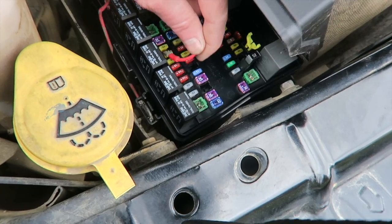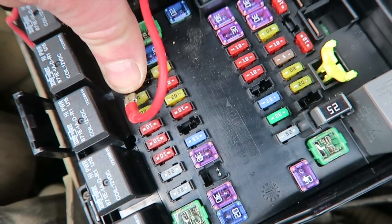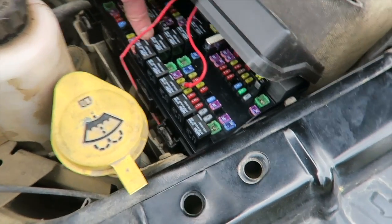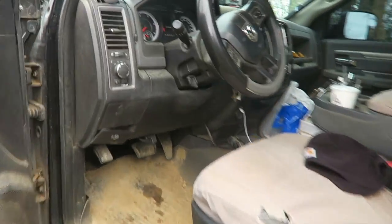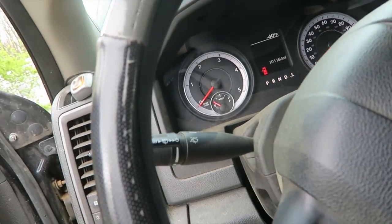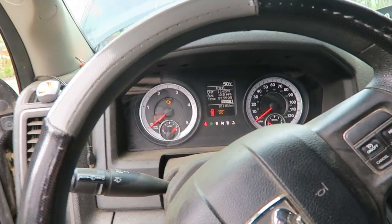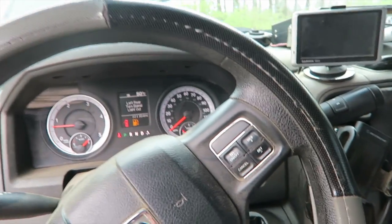One thing, I was hooking this wire back up before I go to start my truck. This wire just goes to CB, I think, or something. But anyway, I pushed down on these fuses, and a lot of them were not pressed in all the way. So something to remember is just go through here, making sure they're all snug. And they're all good. All right. Let's see what happens. Oh, things good so far. I think it's gonna be all right.